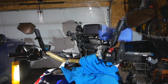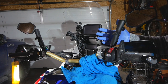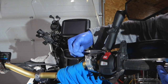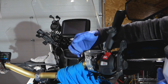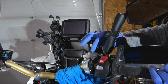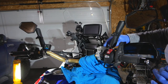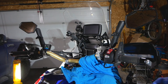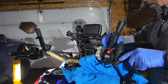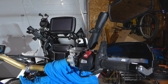Fill the reservoir up to the upper line — the full mark. Don't go right to the top because fluid will squeeze out once you build up pressure in the brake system. The front reservoir has a 'lower' indicator as your minimum; you want fluid all the way up to the full line inside the reservoir. Before installing everything, give the edges a quick wipe to keep it clean.